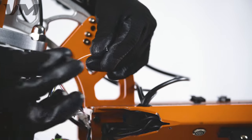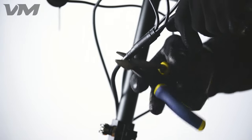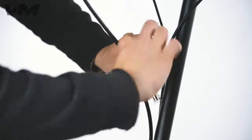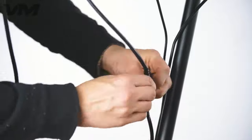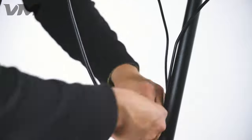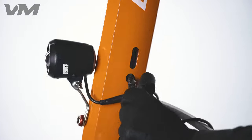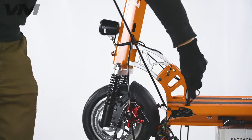With the main connector now disconnected from the scooter, it is time to remove it and put in the new one. You'll use the existing line to pull the new one through the stem. With your wire cutters, cut the old line below where the line splits at the top. Line up the exposed pins of the new line onto the old one and begin taping them together with strips of electrical tape. It's important that you do this as tight as possible so that the line can be pulled through in the next step. Now that the lines are taped to each other, begin feeding them down the stem. Be careful once the tape section gets to the hole at the bottom — thread it through slowly but still using force. Once it emerges completely, take the tape off and pull the old line out entirely.